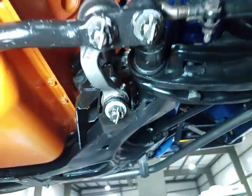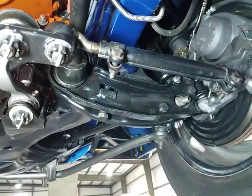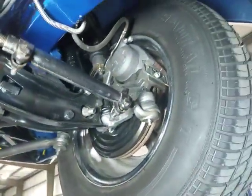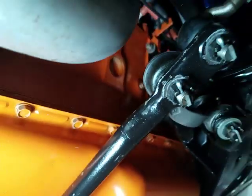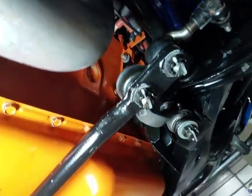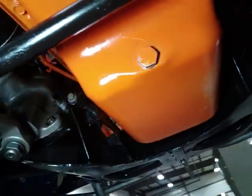In '67, there was no machine pad there on the block above the oil pan rail. Not only was it not blank, but it was not there, at least this early. Side of the block, we've got 9/16/67. September 16th, '67. Early block for a '68.